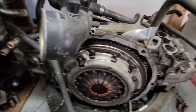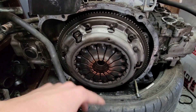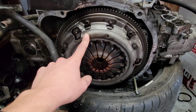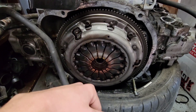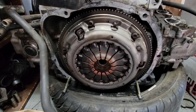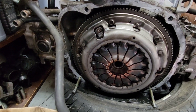The first thing we need to do is get the clutch off this old 22E engine and swap it over. This clutch is already a WRX 06-plus push-style clutch and it worked great before — I'm going to transfer it over. It will obviously hold lots of horsepower for what we're doing. The WRX this clutch comes with is rated for 265 horsepower, so it should be no problem holding our little TD04 22T.